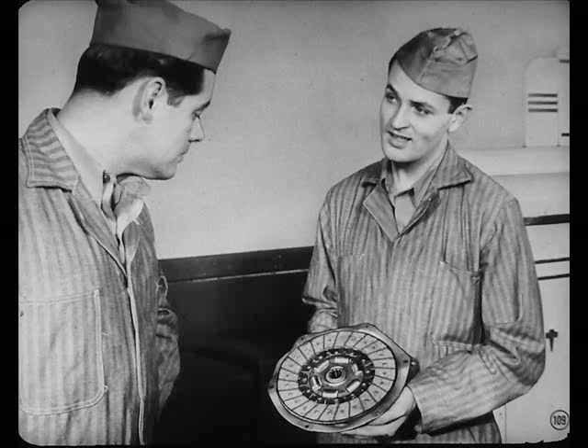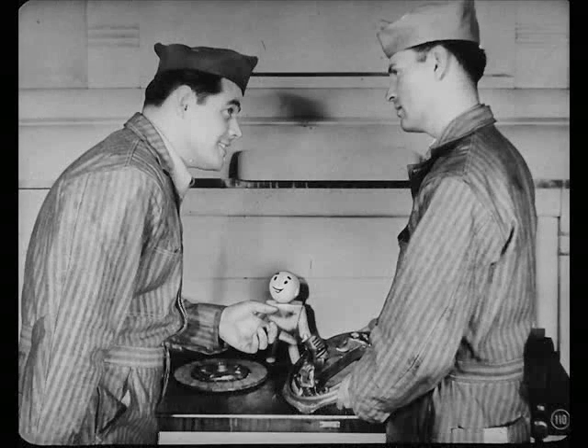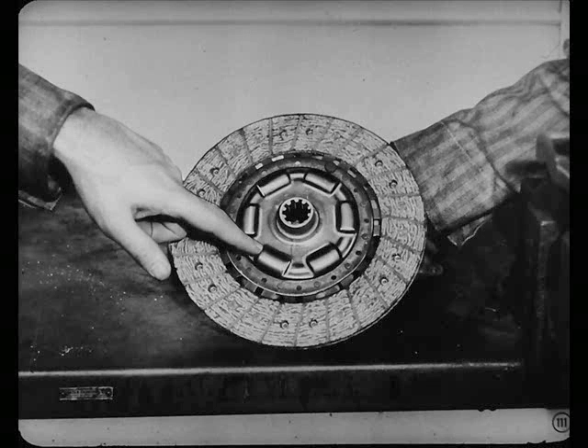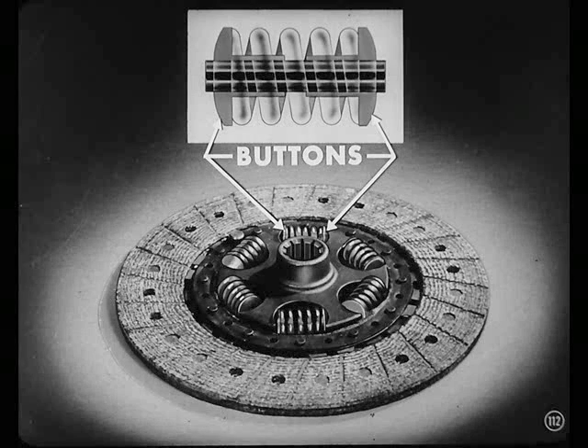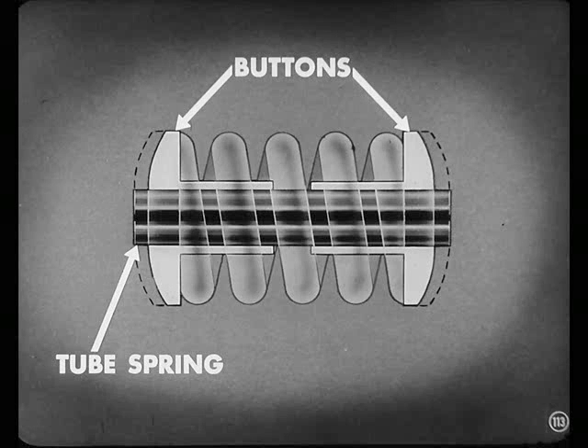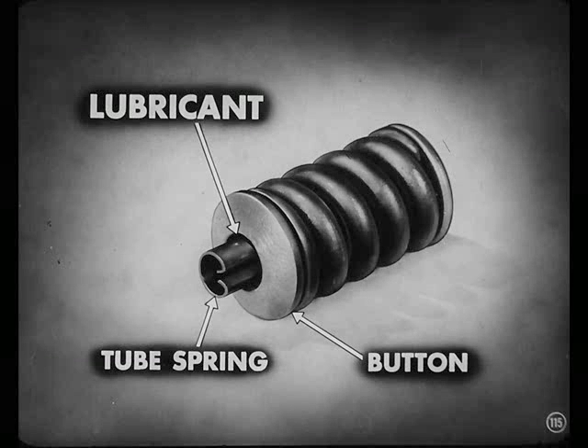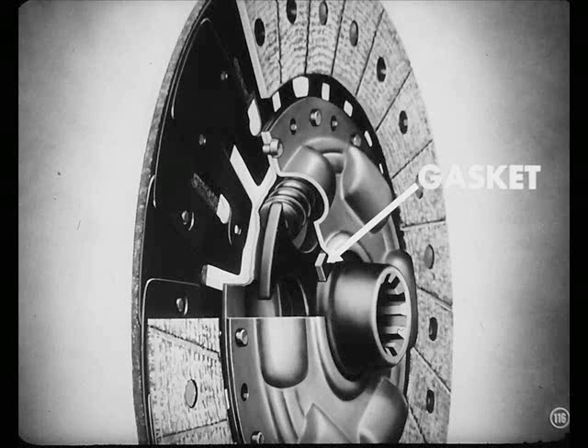How about this clutch? It looks different to me. That's right, Pete — that's an Auburn clutch. The damper springs in this disc are enclosed in a steel housing to hold the grease that lubricates the damping mechanism. How can a damping mechanism work in grease? Well, there's a button on either end of each coil spring in the damper unit. When the coil springs compress, the buttons move along tube springs that are inside the coil springs. These tube springs expand against the buttons slowing them down. Without lubricant, these buttons would soon gall and jam. They have gaskets between the hub and the housing to keep the lube in.